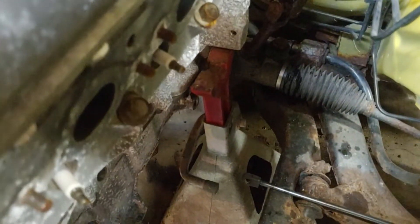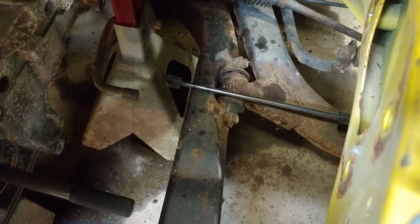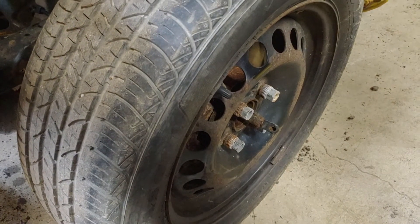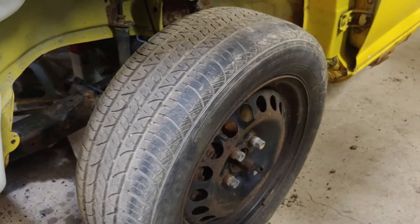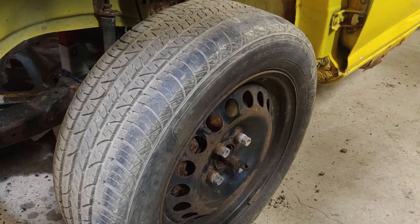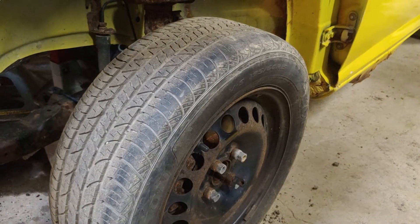The other big challenge over here is going to be that differential sticking out — I'm going to have to get custom CV shafts made. I'm not sure yet whether I want to use the stock Cobalt knuckles or go junkyard diving and find something else. One of the things I'm running into is gear ratios, because these are small tires compared to a Camaro or something, and your standard gear ratios don't work out that well.